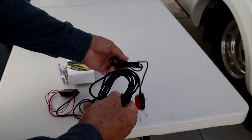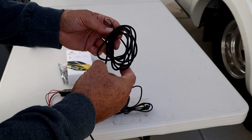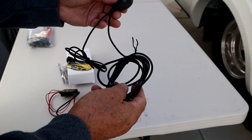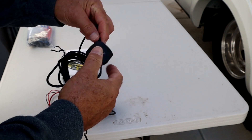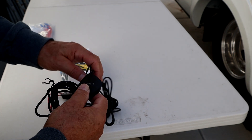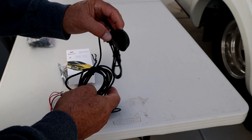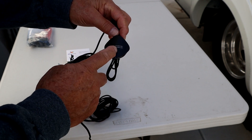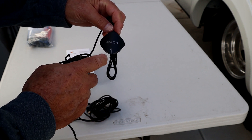The cable on this end is long enough to go from the display down into the fuse box. Pay attention to cable lengths and where your adapter is going to mount — whether it's down in the fuse box area out of the way, or whether it needs to be up next to the display. The advantage of the short-cable model is you can turn it on and off with the button, and use it in always-on mode even when the ignition is off.